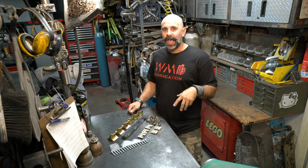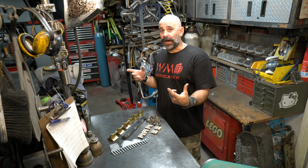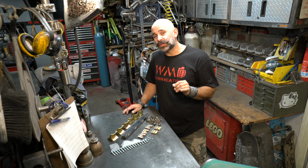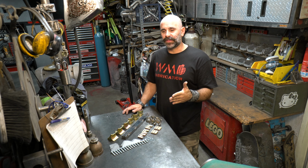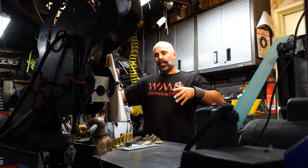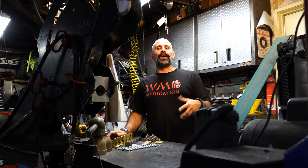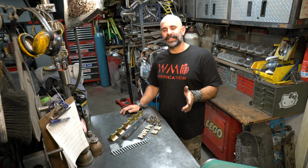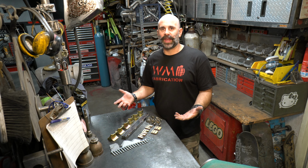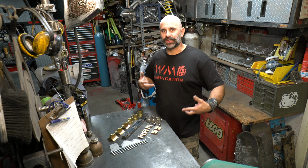And that's very terrifying. There's a lot of products out there that are essentially offset spacers for your rack. And those things are terrible. People use them. You can get by with those, but what they do is they move your tie rods forward and that corrects for the over-centering. Now, that's okay, that's fine, but when you drive on that thing, it ends up flexing your rack. And so it creates a lot of unnecessary strain on your rack when you're drifting a lot. It's going to wear out your rack bushings, it's going to wear your rack out and just destroy that.